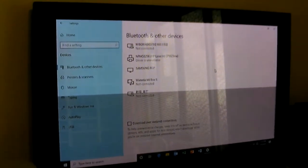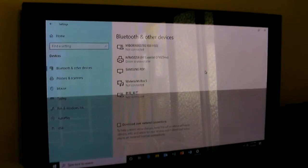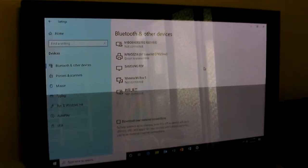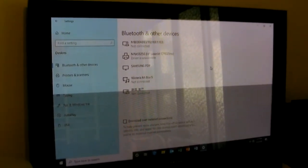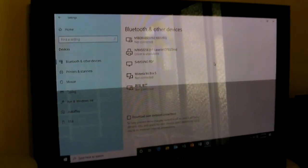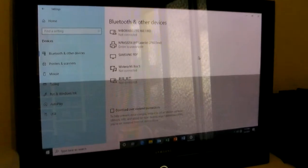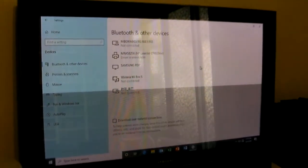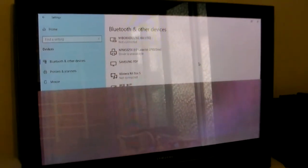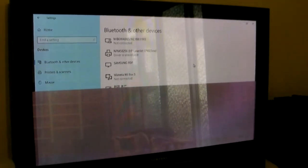I don't have a VGA cable, but I can probably get one in the neighborhood somewhere just for quick troubleshooting. But that's what's going on with this Samsung plasma: it's going from a flawless screen to this grayed out bit to a completely scrambled screen spontaneously. The other thing that's interesting is that when you plug in a new source, it re-scrambles. See, it's just spontaneously doing this. I'm not doing anything to make that screen behave in one way or another.